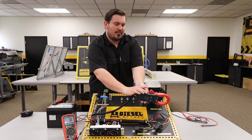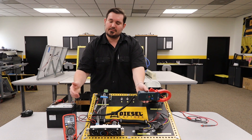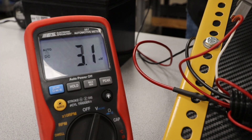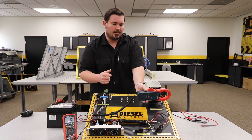So now you'll see I have an amperage draw on low speed, which is currently 3.1 amps. Now remember, it says 3.1 MV, which is millivolts. But it's a one-to-one ratio because that's how it must be set up — so this is actually 3 amps of current.